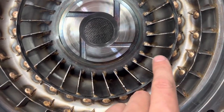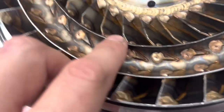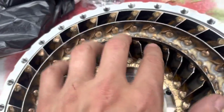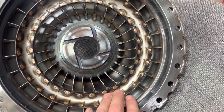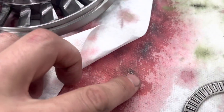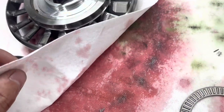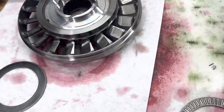You can see the same little material that hit these also hit these up here. So definitely a little chunk of something got in, probably from the transmission, and that's why I'm having the transmission gone through. But it doesn't look anything serious, like no big chunks fell out. Honestly, the only thing that was coming out was some of this fine little silver material. So the transmission's gonna get looked over and cleaned, so maybe Tommy will find something in the tranny that needs redone.